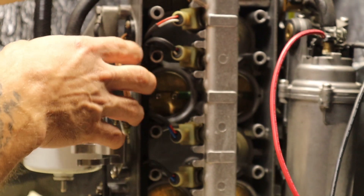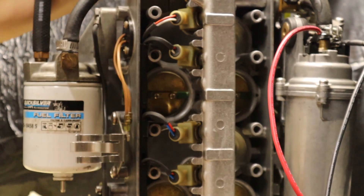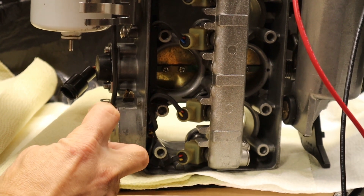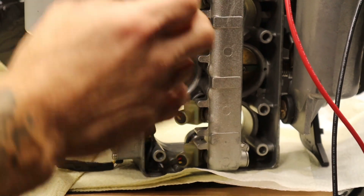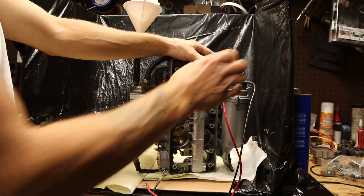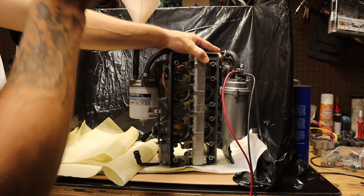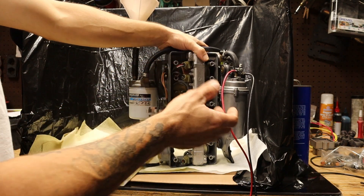The other three colors are going to be individual positives — three separate circuits that all share the same ground. I have a white pair on the top two, blue pair on the middle two, yellow pair on the bottom two. So if I put my negative source on the red pin and then tap each of the other three color pins, I'm going to sequence-fire my injectors. They fire in pairs, so that's something to consider. I've got power to my fuel pump and I've got to get power to my injectors to figure out if they're going to fire.